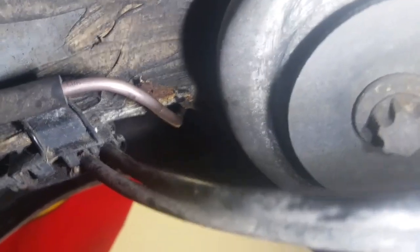That's our cunifer. There's quite a crucial bend here, where it wraps around the inner arch here, the bodywork of the car. You need to make sure that that is clearing that. You can stick your fingers in and adjust it and give it a wee pull and a wee bend, just to make sure that it ain't gonna rub. So you don't want that. Let me see underneath the car again. So get the torch out of the way. There's where it is coming up and round the wheel arch. There's a good 10mm clearance there.